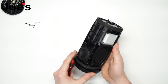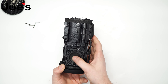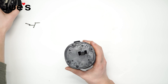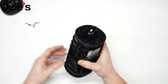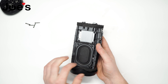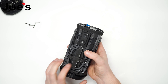Let's remove the four screws for the speaker. At this point, you should be able to identify which speaker is damaged by just looking at it if you see visual damage. If you don't see visual damage, just play some music — have this back on there and listen and see what side is bad. Also, a common issue is a passive radiator going bad — it may sound like a bad speaker but it could be a passive radiator. Check if there's any tears anywhere; we sell those parts as well.